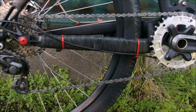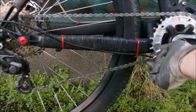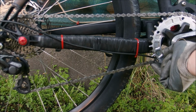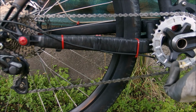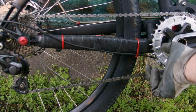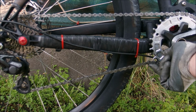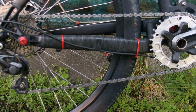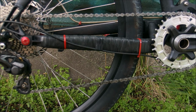And the solution would actually be a pulley here around the bottom bracket, which shortens the length of this chain, makes it pretty much impossible to drop the chain from the chainring when backpedaling or actually riding. And that would work. However, it's ugly, it's not really useful for everyone, and it introduces a bit of drag. Answer: the clutch. So how does a clutch derailleur work?